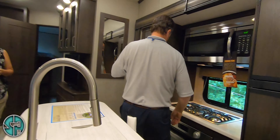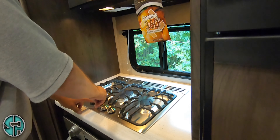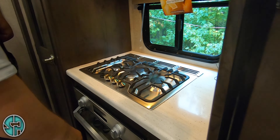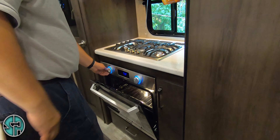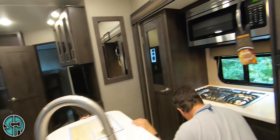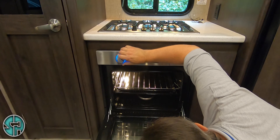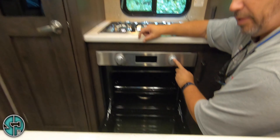To light your oven, hold this down — push it down to where the flame button is, then push your igniter. To light the stove, just turn the knob over here until it's clicking, then when it hits it stops clicking — the pilot should be on. Come down here and you can see it's lit. Hold it in for a few seconds for it to catch. Once it catches, let it go, then turn it and there's your burner. And this is the timer right here beside it.